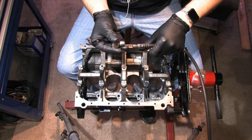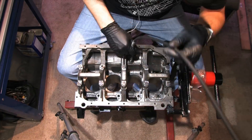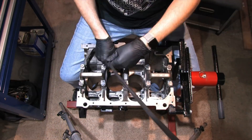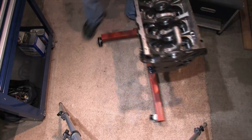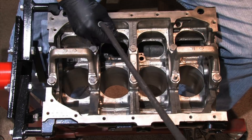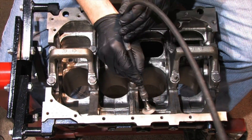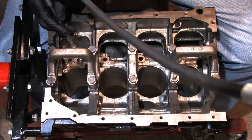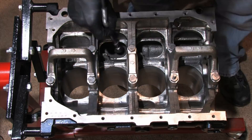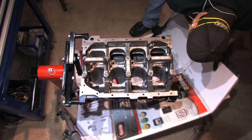Now for the big brush. I cover all the large flat surfaces first and then go back over all the places I just scrubbed with the detail brush as best as I can to blend it. One of the places it's particularly hard to reach is the front balance shaft housing. I don't know if I did a bad job cleaning it the first time or if a lot of sand and carbon leached out during the powder coat baking, but all that stuff has to go before I coat it — otherwise I'm going to be painting a sacrificial layer that might compromise the coating later. Absolutely every surface to be coated has to be abraded and scuffed up.